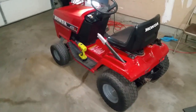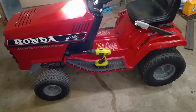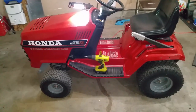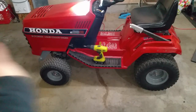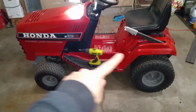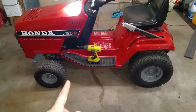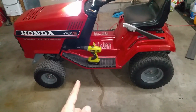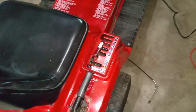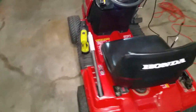Hey everyone, welcome to my channel. In this video we are going to be working on a Honda 3813 riding lawnmower with a liquid cooled, two cylinder engine. The owner wanted me to do a full once-over on the machine. There are a few issues going on: there's some sort of safety switch issue where the machine will not start sometimes and then other times it will. There's also something going on with the drivetrain — this one is a gear shift as opposed to hydrostatic. It is five speed, and from what I can tell, this machine is definitely in good shape considering its age.